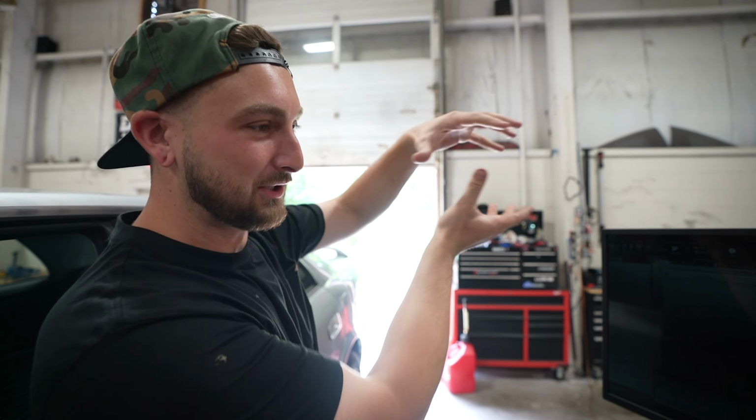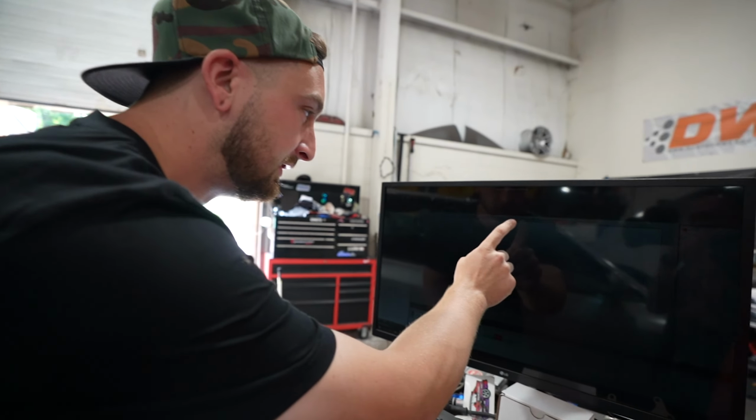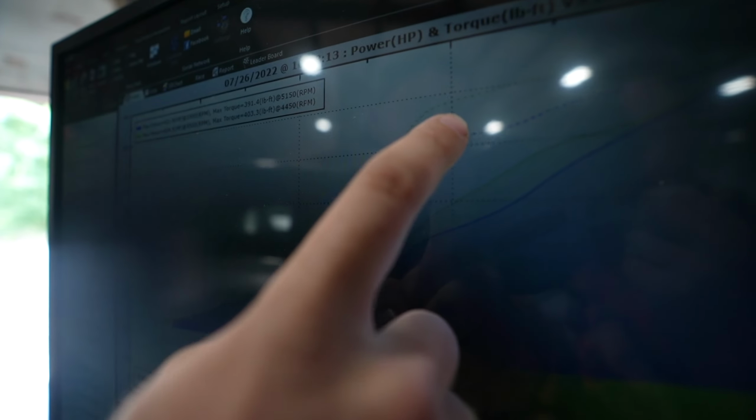When tuning an engine that doesn't technically have forged internals, you have to be very, very careful of torque coming in too hard. Torque is what blows engines apart. We say it all the time, especially torque down low. I don't care what you say, dynamic cylinder pressure is just more destructive down low. So when torque comes in dumb heavy at 4 grand, this is where we would pop an engine. Boom, right here, right? So we're gonna try and control that a little bit.